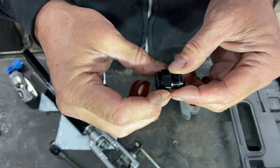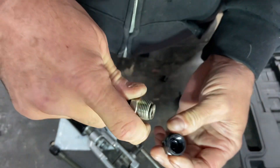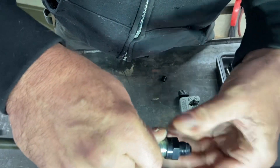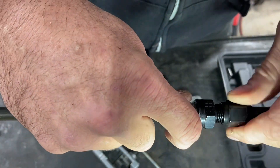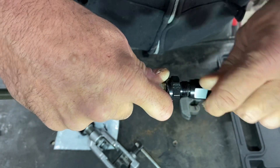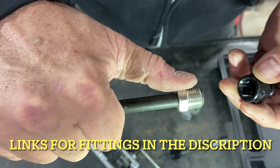So like I said earlier, I wanted to show you this fitting here. This is to take your normal double flare type of fuel line or brake line — if you look down inside there, you can see it's got the flare for one of these style tube nuts for your regular 45 degrees. You put your fuel line on like that, and it works just like a normal AN fitting at that point. So you go from your 45 style to a 37 degree style AN fitting. These work real nice for systems that already have that style of fuel line, which is just your standard double flare, and you can adapt to dash 6 AN.